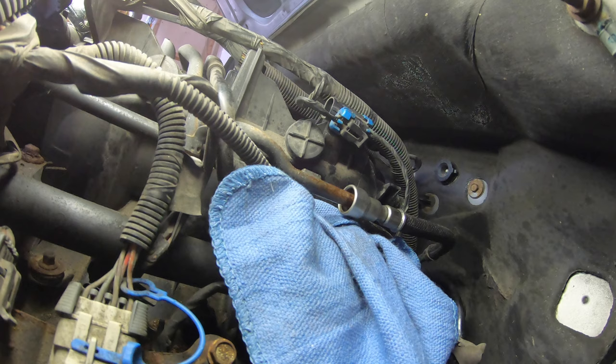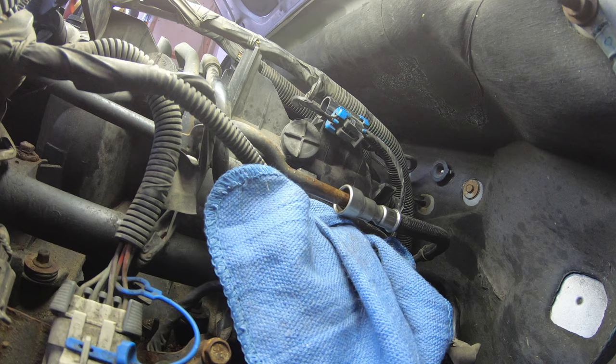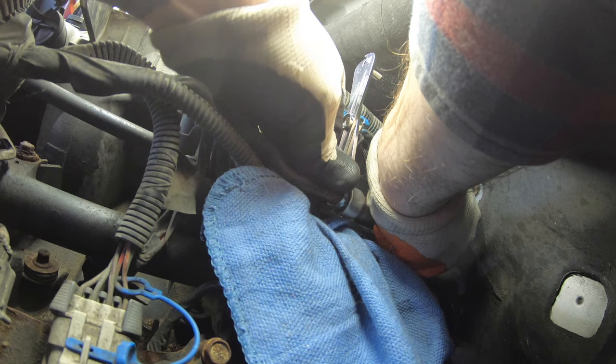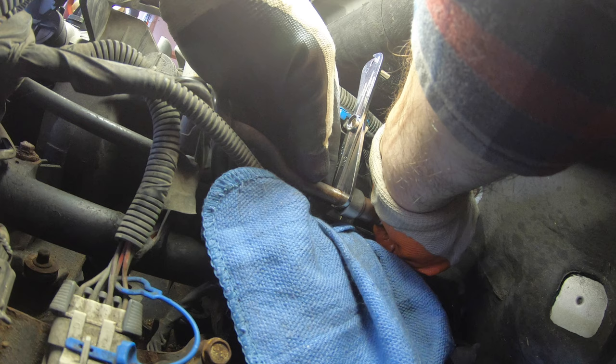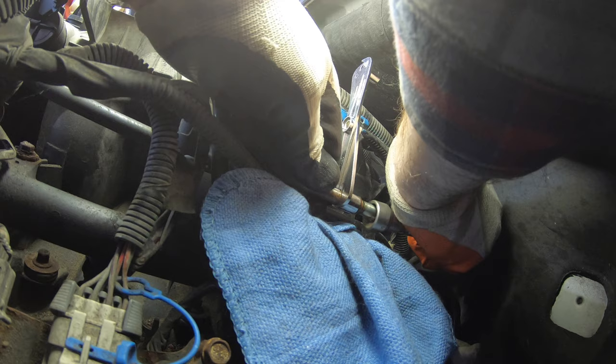And this will be a little difficult for me, but you'll be able to see it. So I'm going to show you what I mean. You're going to put your tool in, and you're going to hold this fuel line. You're going to pull it towards the front of the car, and then you're going to push this in. And you just saw it just push in — I'm pushing it with my left hand too — and it very easily just pushed right in. And once you push it in and it's in there, you can now pull that out very easily. Make sure you have a rag.